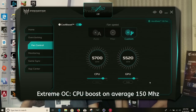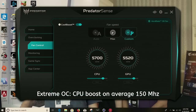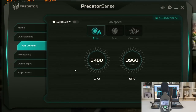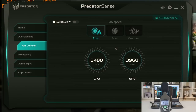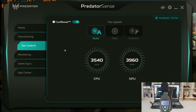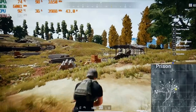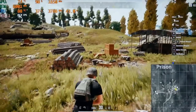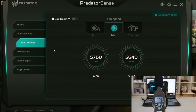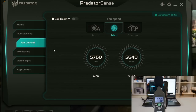The CPU was boosted on average by 150 MHz. There is good fan control; under load on the auto fan setting the fans spin producing about 42 decibels of noise. Activating the cooler boost option seems to do very little, and with this setting you will see CPU temperature spikes into the 90s in games like PUBG. Max fans definitely crank up the fan speed to a pretty loud 54 decibels, but if you don't use turbo mode it will keep your laptop cool.